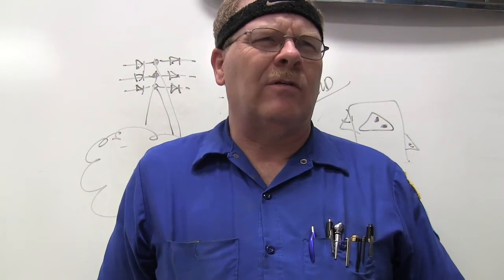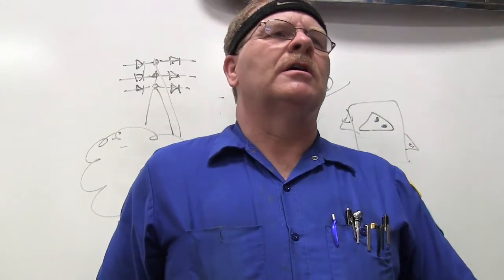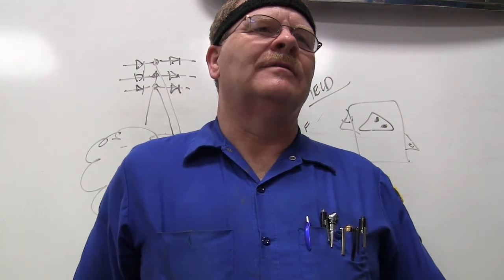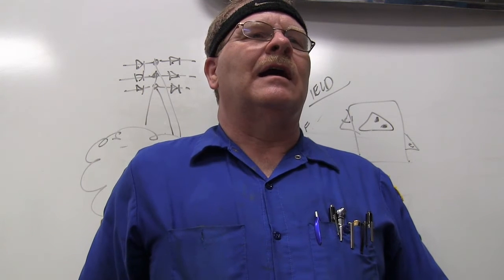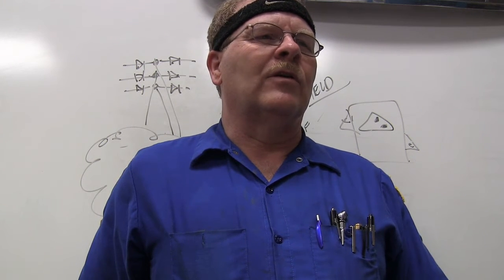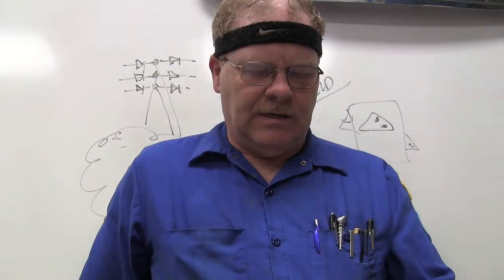And that pulley on that alternator I've got laying on the table there off that Lexus is larger than what you usually see, because they figured it was turning fast enough to produce what it needed to with that bigger pulley. Now, a lot of the time, if you're really tacking that out on your car, like if you're really going fast, you're going to be spinning your alternator as much as 14,000 RPM.